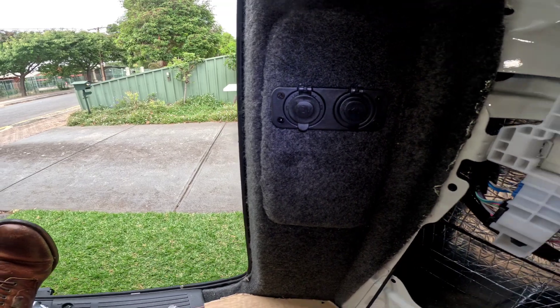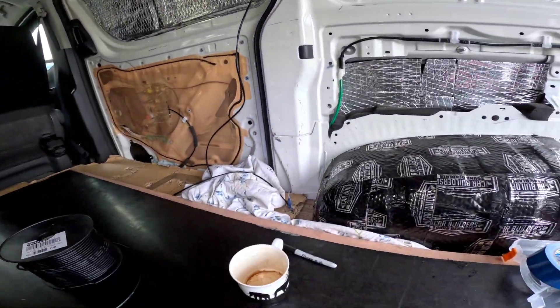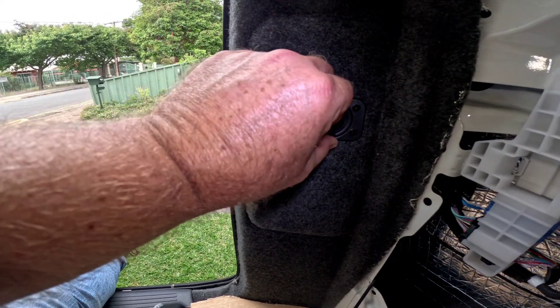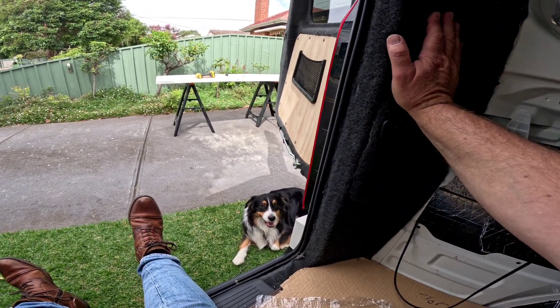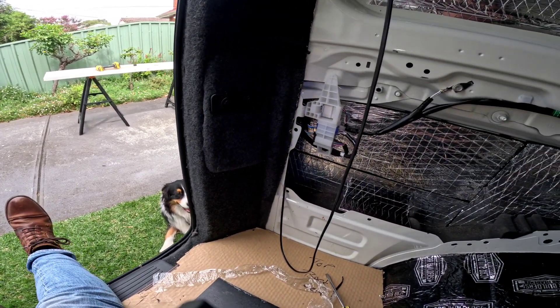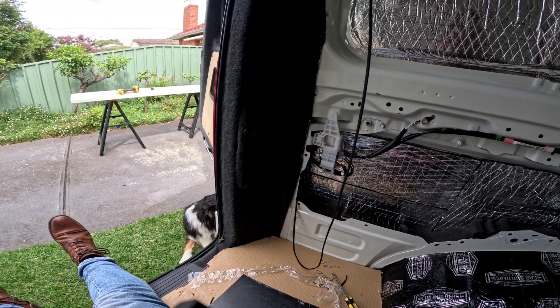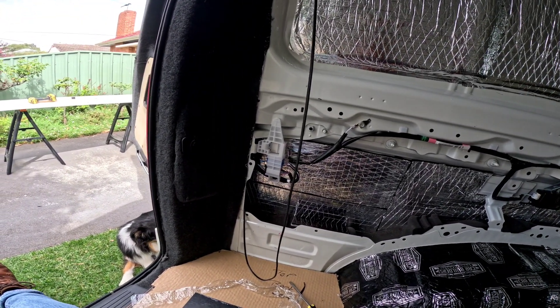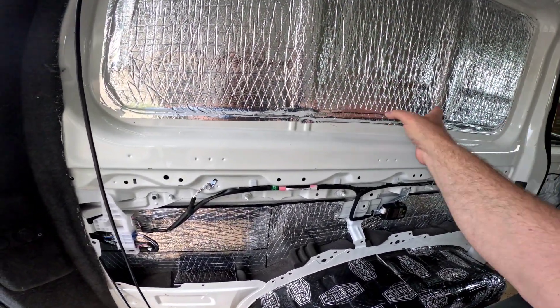So let me show you what I've done. So far I've put a USB and cigarette charger over here with the cables going all the way up, and then they will come down to the fuse box over there. I just bought this at Jaycar — a cigarette and USB combo. The great thing about this is I've always got power over here regardless — whether it's for an awning light or just as a spare. I don't want to run cables all the time just because I forgot to do something. I may be doing a little bit more than I should, but I'd rather actually have it than battle after everything has already been laid out. We've got two lights over here coming up — I'll do the cabling and run it behind the board.